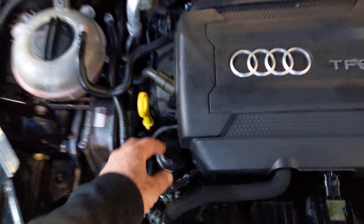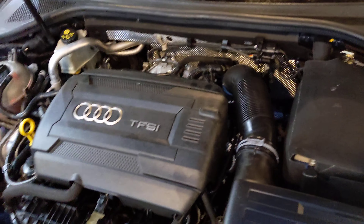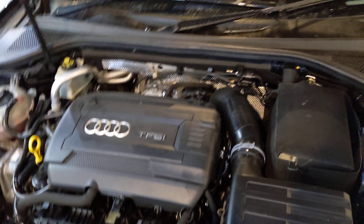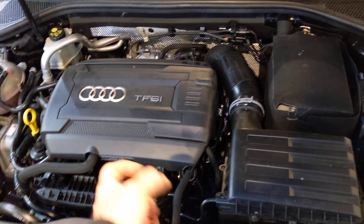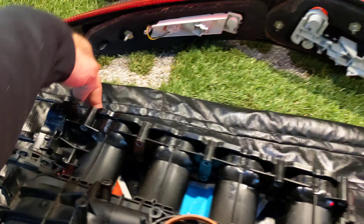I removed the oil filter as well. Just watch that this corner — like on other versions of the engine — touches the cam sensor. There's a cam sensor up here, and you will rip the connector off the cam sensor if you're not careful with the manifold.